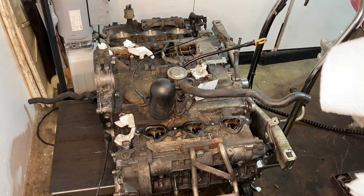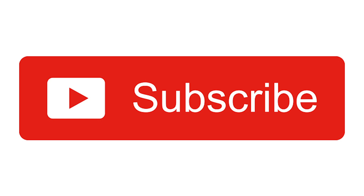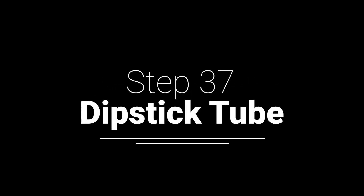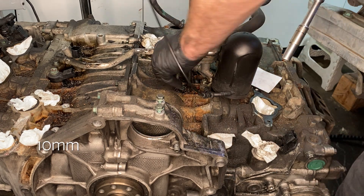Filling up those holes again. We can actually see into the valves there, which will come in handy when we try to find top dead center. A nice easy one next — the dipstick tube. It just has one 10mm bolt at its base and then it just pops out.